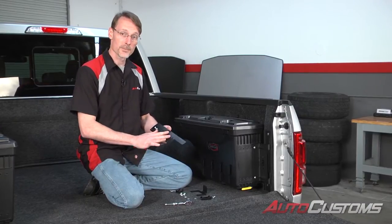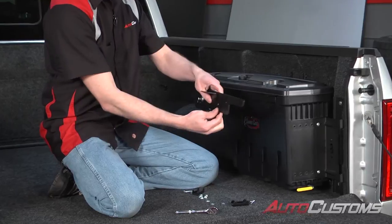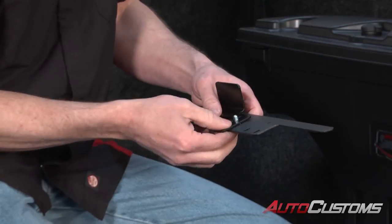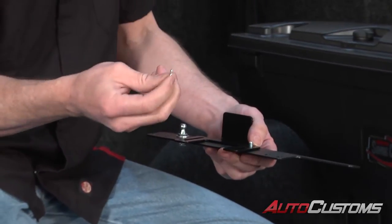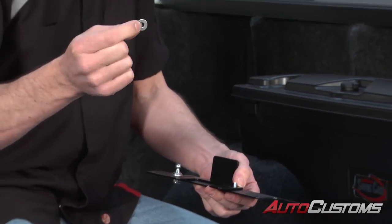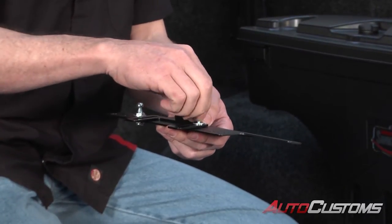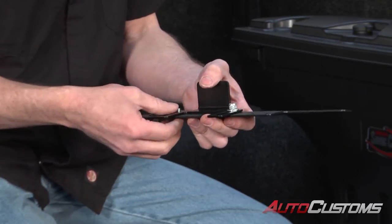Before we get started, we're going to assemble the brackets. This is the rear bracket and this is the strike plate. We're going to set that strike plate on top of the rear bracket with the strike plate facing the top. We're going to take our short carriage bolts and go up through the bottom of that bracket, making sure the square head of the carriage bolt goes into the squared-off section of the bracket. We're going to take a washer and set it on top of that carriage bolt. Now it's very important — something a lot of people don't know — washers are stamped out, so they've got a sharp edge on one side and a smooth edge on the other. We want the smooth edge to face our powder coat so it's not scraping the powder coat off as we tighten down. Then we're going to take our nylock nut and just get that started on top of that carriage bolt, and do the same thing with the next carriage bolt.